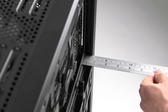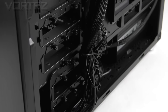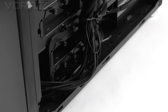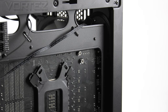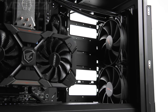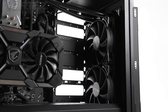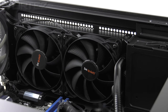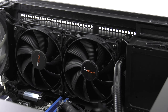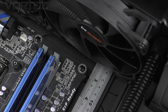The space behind the MOBO tray for storing cables is limited — around 1cm. However, there are some indentations towards the front that help, and there are gaps to tuck away redundant cables. For the CPU power cable, you can remove the SSD bracket, feed the cable in, and reattach the bracket afterwards. For water cooling there is quite a bit of flexibility: at the front you can install up to a 360mm radiator — we have a 280mm here for demonstration. At the top, with removal of the optical cage, you can go up to 420mm. We've also installed a 280mm at the top to show clearance, and with the fan and radiator together there is still some space left over at the top of the motherboard.